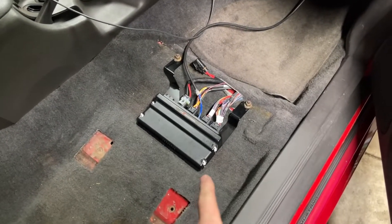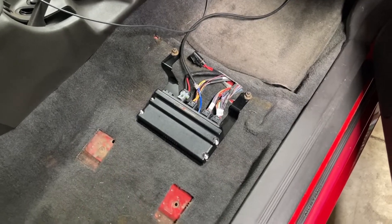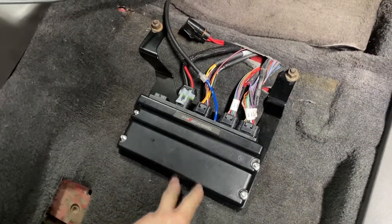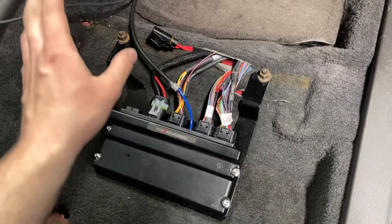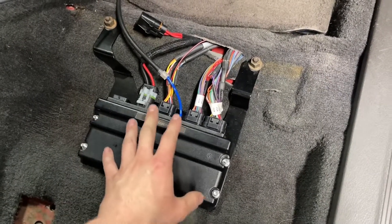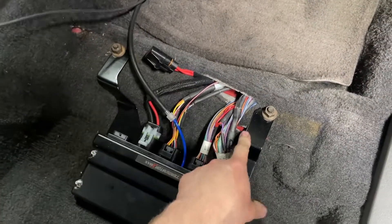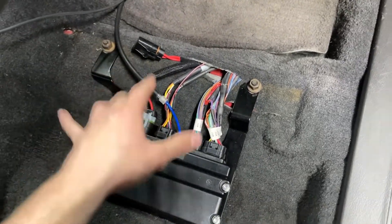For starters guys, I decided to mount my Holley underneath the passenger seat. Holley sells this bracket for the Fox Body and SN95 New Edge — pretty much 79 to 04 Mustangs — for underneath the seat. It just bolts into the stock bolts, or studs. These will be taken off once I go put the seat on, and then the seat just drops on over top of it.